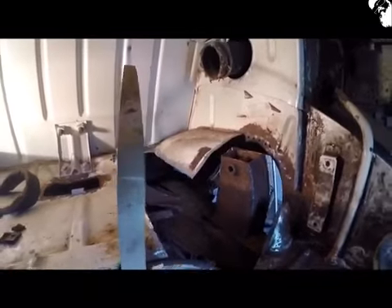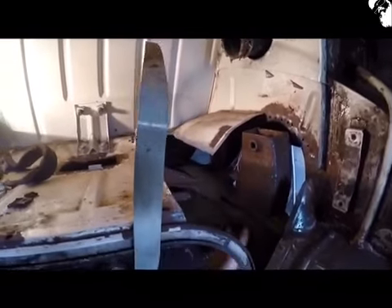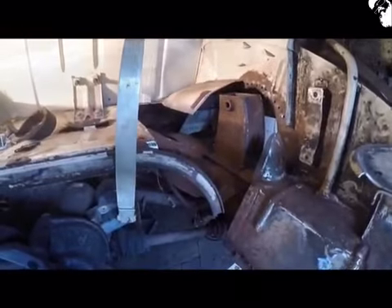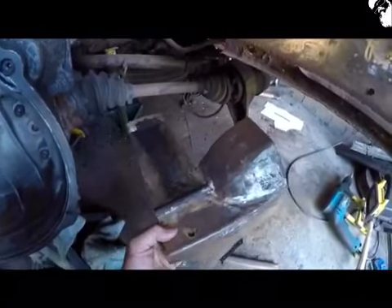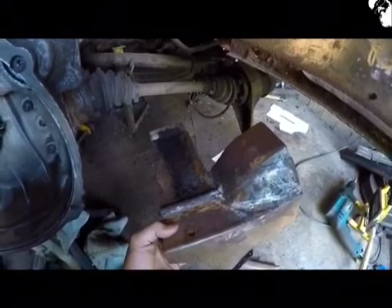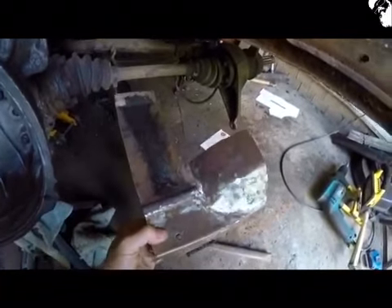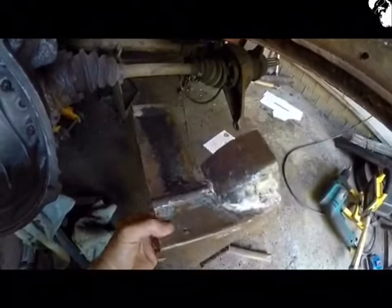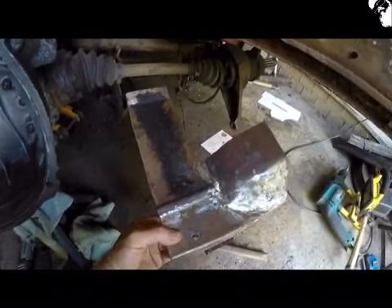More and more rust cut out all the time. I'm just starting to clean all these chassis rails down while I'm in there. Got this panel made up now — it's actually made of three separate pieces of metal, and it's a little bit flash rusty where I've been experimenting with a little bit of lead just to fill in the seams. This brace bar that I showed you earlier — I'm still yet to find the proper angle of those panels underneath there, so once I get that done I'll be able to weld those gaps up.